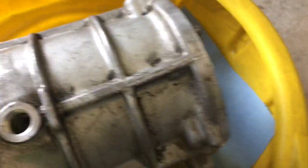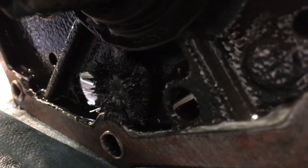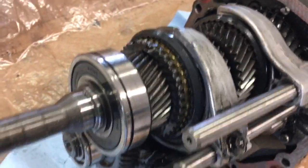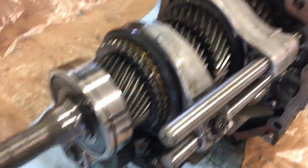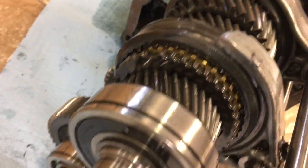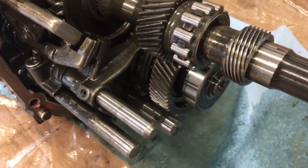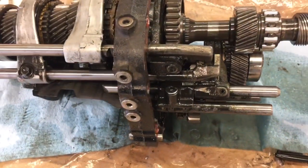I wanted to clean out this sort of sludge and buildup. Also, if you peek over here, you can see the little magnet — you can see it picks up all the shavings. I wanted to get in there and clean that, and also visually inspect the gears. That way, over the next five or ten or even more years with the truck, I'll know the state of the synchros, how the transmission is put together, whether anything has chewed up the gears, and how the bearings are.